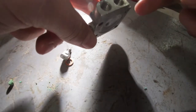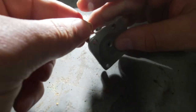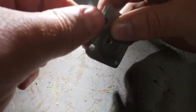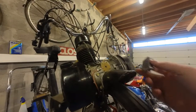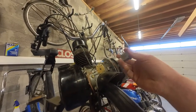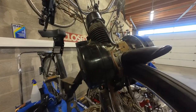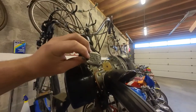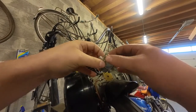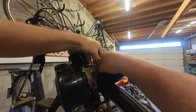Other than that, there's not much to it — just clean everything out, make sure there's no dirt in there, and put the ball back in and reinstall the screw on the top. The ball can't be stuck. Reinstalling the fuel pump is pretty easy. There is a little plastic piece that has to go first — there's a hollow side to it and the hollow side has to face the fuel pump. Then you put the little membrane on and mount it back up.